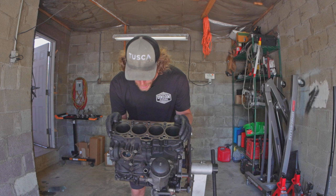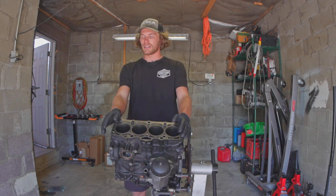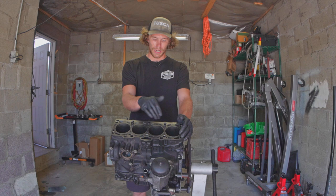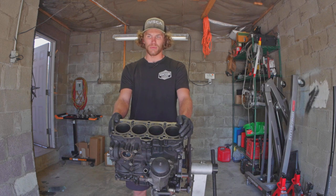It is time to hone the cylinder bores. Everything else is off the block. I already took the oil squirters out, so we're going to go ahead and hone this today. We're going to clean the threads in the block deck today, and then crank can go in, bearings can go in, tolerances can get checked — but only after everything is super, super clean.